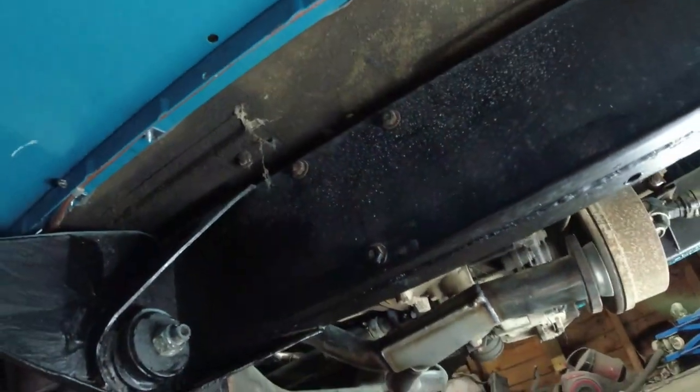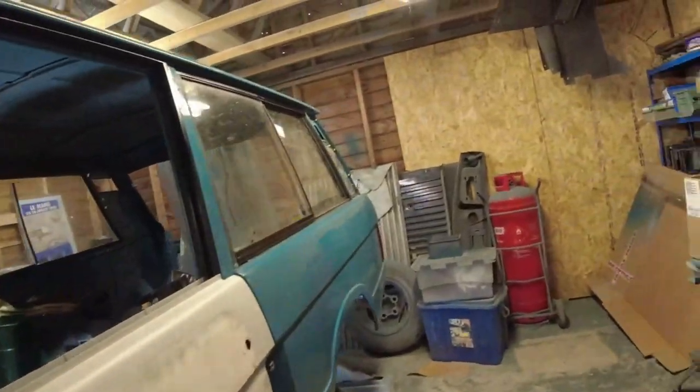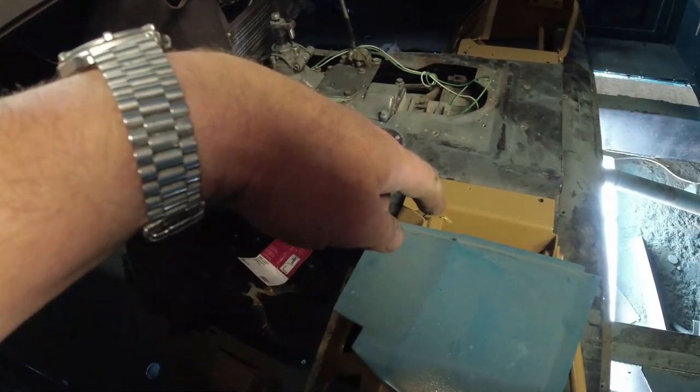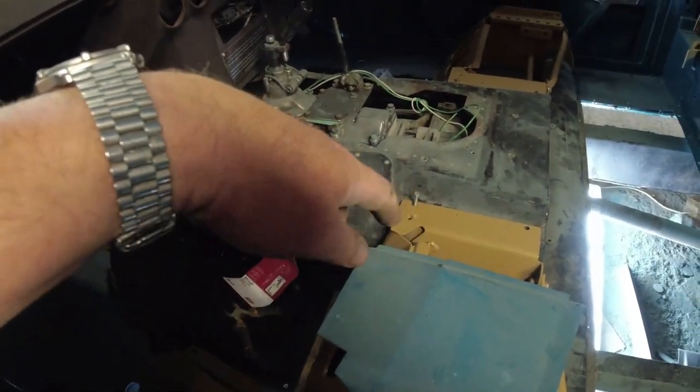Now, the other challenge, there were two challenges, that was the one challenge, that was fixable. The other challenge that is less fixable, every single one of these LT77 Borg Warner adaptations goes into a car where the chassis mountings are about a centimetre higher.